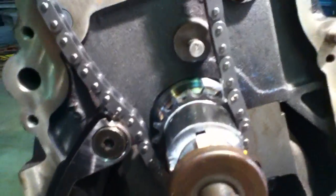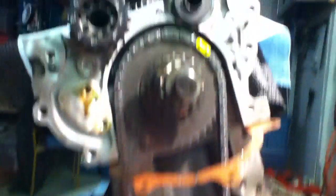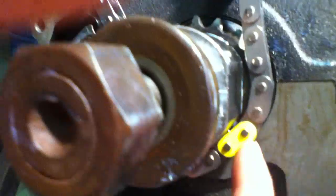The part I wanted to get to is I couldn't quite figure this out, and there's probably other people running into the same problem when they put on their lower timing chain. There's a long side and a short side to this timing chain. You see there's a yellow marked link on this chain up top and a yellow mark on the bottom. It's actually set up perfect right now except I don't have any tension on it. There is a mark behind this yellow link right here that's for the crank mark — that's where it's supposed to match up.